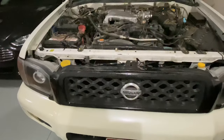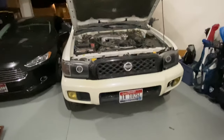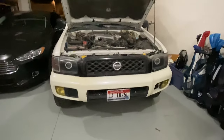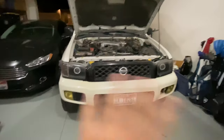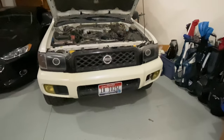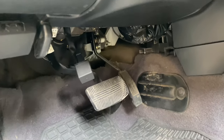The nice thing about this kit is that everything that comes off the blue controller box is a plug, and everything off the headlights and halos is also a plug. So even though it's a DIY kit, you end up with a plug-and-play headlight assembly. For example, I'm putting new lenses on — all I have to do is unplug a few things and take out the headlight assembly. That is part of why this kit is killer. Compared to a janky setup where you're tapping wires everywhere and have to break apart your whole wiring harness just to remove a headlight — BX Built makes a great kit. Depending on the application, to keep your halo LED switchbacks from hyper-flashing you need to change out your flasher relay.